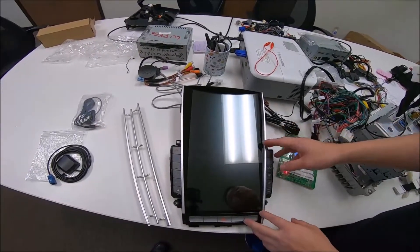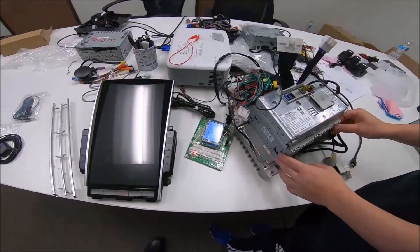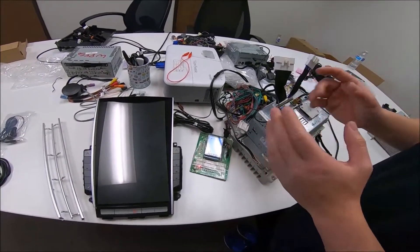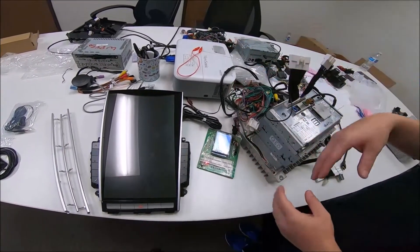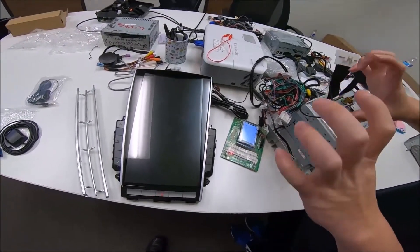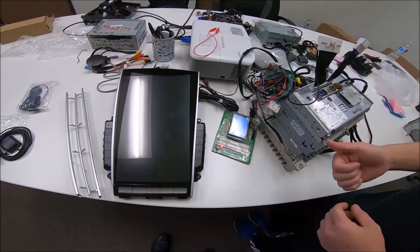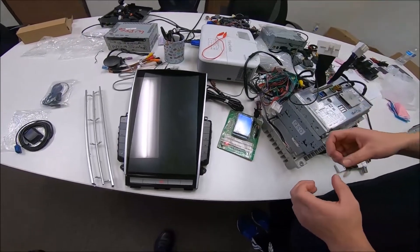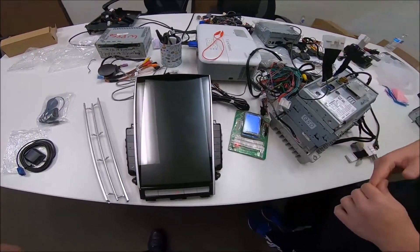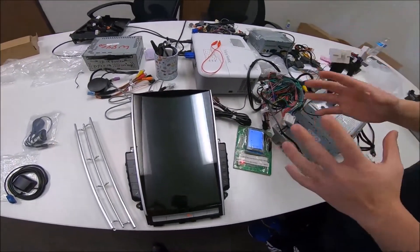With the new iteration of the Mark III, a couple of things we've improved on: you no longer need to take out the factory CD player on the Q50 or Q60. Previously you had to remove the CD player and use our proprietary brackets to reposition it. With the Mark III, all you need to do is take out the front panel with the front screen and leave the top screen at the top of the car — no CD player removal needed. If you have the Mark II or Mark I, you still need those brackets, so let us know your order number and we'll send them out.